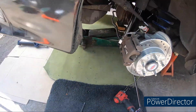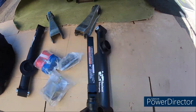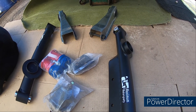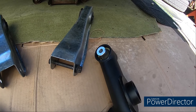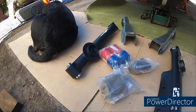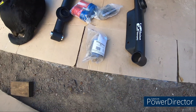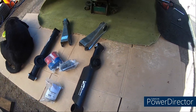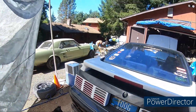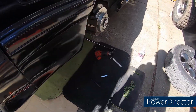We're doing it on both sides. These are the heavy-duty rear lower arms from Maximum Motorsports - they have one side spherical bushing and the other side will be poly bushings. I also bought their tool to help me out with the install of those upper control arm bushings.